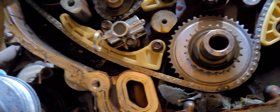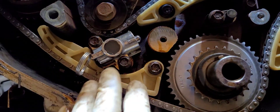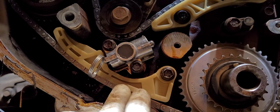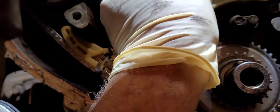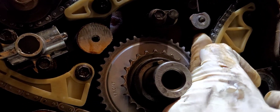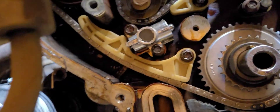So now we've got the tensioner in place. I leave it for last and go ahead and tighten all the rail bolts, the guide bolts. Leave the tensioner for last. Make sure this rail is free. It's also a good idea to make double sure that the chain is laying in the guide — it's got little guides on the side here on front and back for the chain to lay in. Once you get that done, you just take this pin right here and pull it out, and you're done with that part. Oil pressure will take over and tighten that up when you crank it.